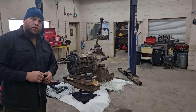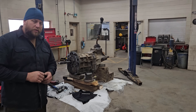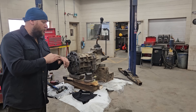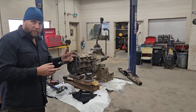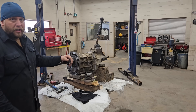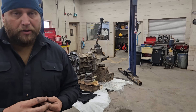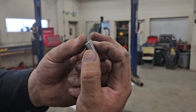There are detailed instructions that come with this kit. I'm doing them a little bit backwards — the first part of the instructions says to prepare the bell housing, but I want to mount the adapter plate to the transmission first so it can help me in preparing the bell housing, since you have to drill holes into it. One thing you have to do is keep the dowels that go in here. Unfortunately I lost one, so I just took a piece of rod, ground it down a little bit, and made a dowel.